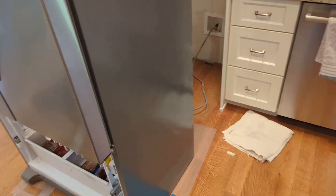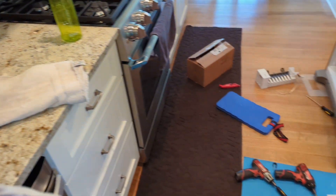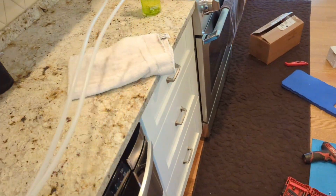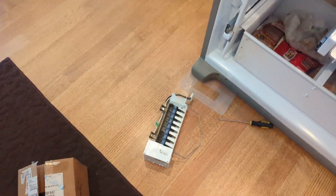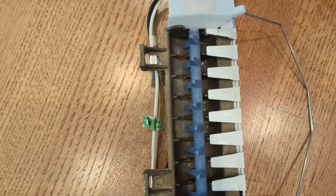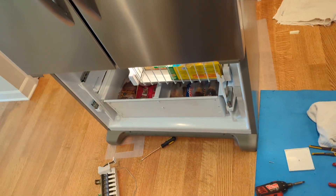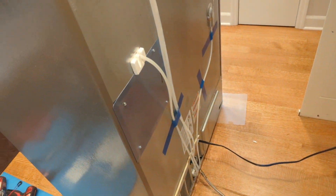On this fridge there was another issue. First, there was not enough water pressure, which ended up requiring replacing the filter housing — that's why not all the ports were filled with water, a slow slow failure. So hopefully you only have one issue to resolve, but on this one there were two things.